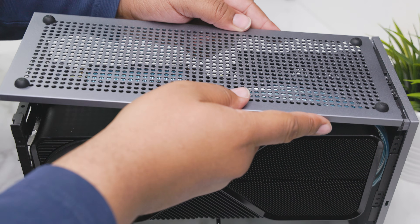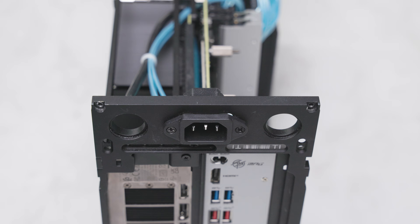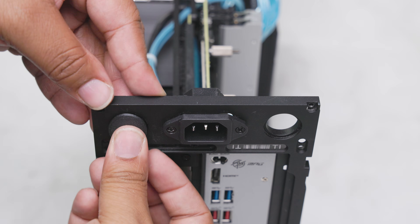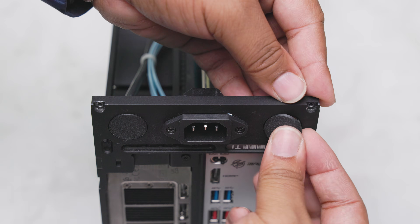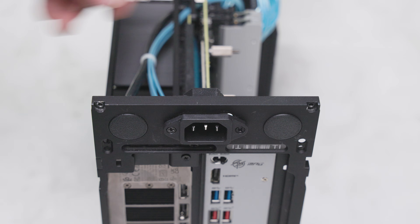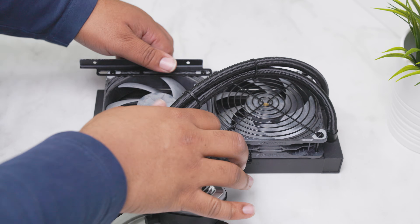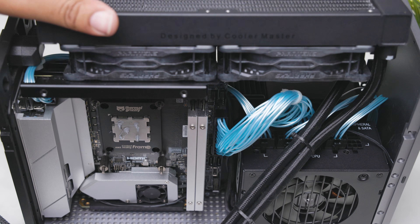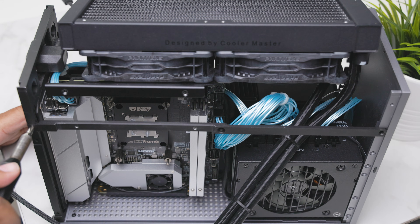I really might consider inverting this case so I can actually see the cables from the top. Unfortunately, the T1 doesn't come with anything to cover the back holes, so I 3D printed a couple of caps — I'll put a link in the description for where I got these files. I wanted to really max out my cooling, so I went with the Phanteks T30 fans; before I had the Noctua NF-A12x25mm fans. It's a good idea to route the tubes before you put the side shroud on — this helps fit the actual pump block in.